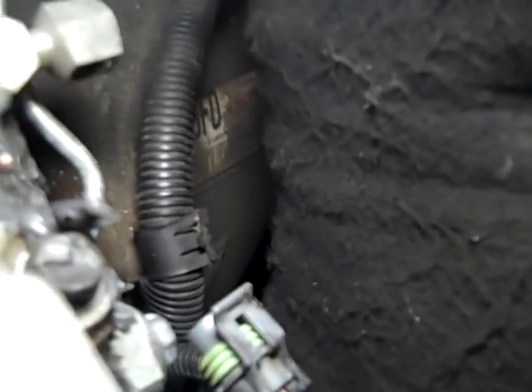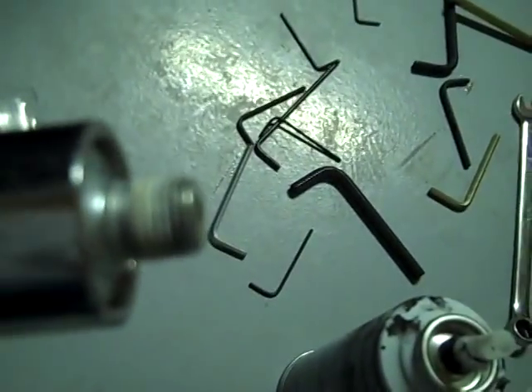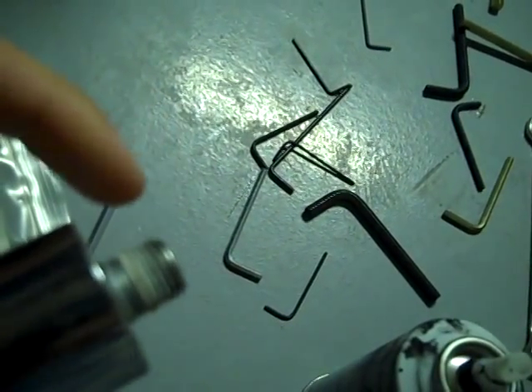That covers oil adapters on a Chevy small block. Speaking of oil pressure senders on the 87 and up center-bolt motor, it's going to be tapped back there as I just showed you — you can't really see it, it's so hard to show. You can see it in the upper left of the frame. That piece will be tapped or it can be plugged; that's one of your oil ports. Down here next to the oil filter there's another hole that can be tapped but it's plugged off in this car. On earlier cars, the hole in there is a quarter-inch national pipe thread.